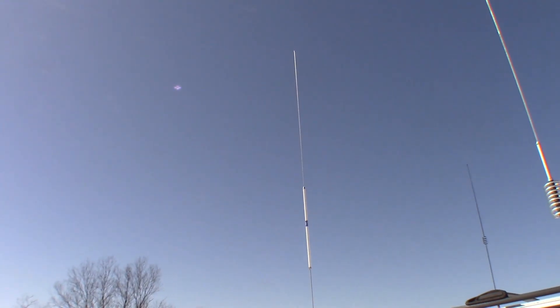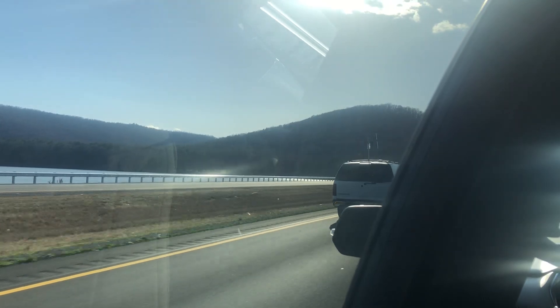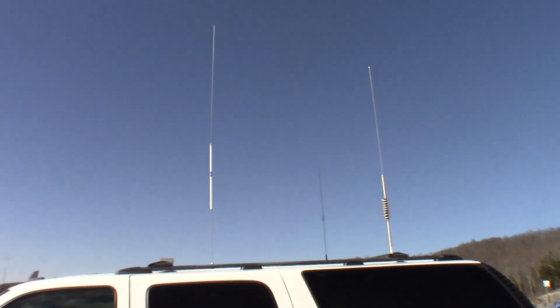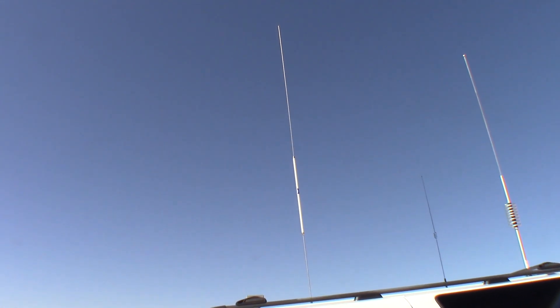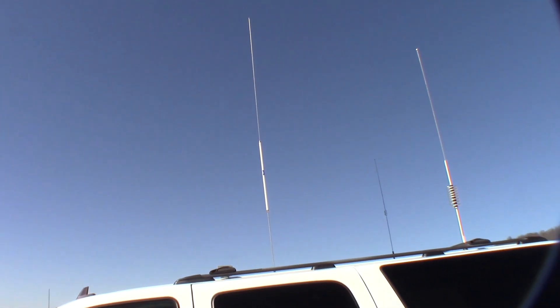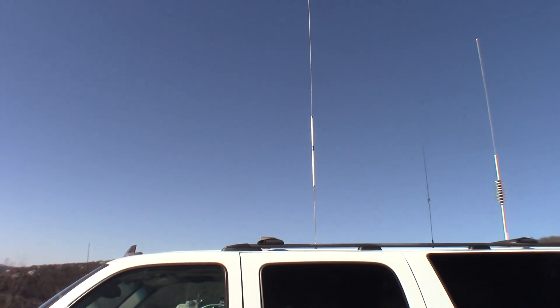Let's talk about this antenna when you drive down the road. Here's a video overlay of the antenna at about 60 miles per hour — as you can see it does bend in the wind quite a bit, but the performance really doesn't degrade all that much. Your radiation pattern has changed because the antenna is bent, but overall range doesn't become completely useless at high speeds. In hilly or mountainous areas you'll get more signal fluctuation than with a lower-gain dual-bander. This antenna has about 5.2 dBi of gain, which is the most gain of any commercially available mobile antenna. The only one that comes close is the Comet SBB7, which I believe has the same gain, but that is a dual-bander — this is a mono-bander.